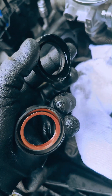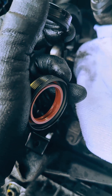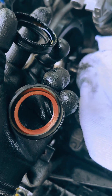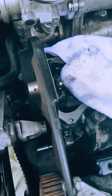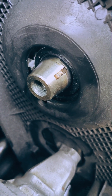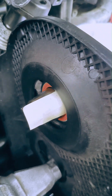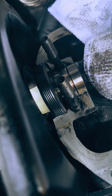Further service includes the camshaft front oil seal. It's a lip seal under the forward cam journal bearing cap and sits behind the cam timing belt sprocket. Again, this is a sensible preventative measure while having the timing belt off. To install the new seal, it's important to protect it from the keyway of the camshaft snout when seating the seal.